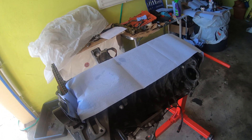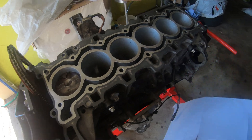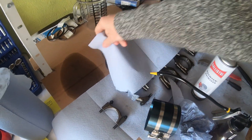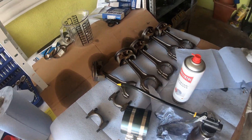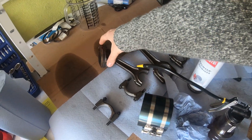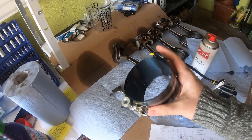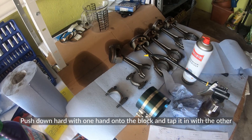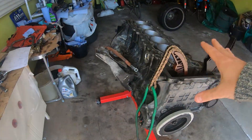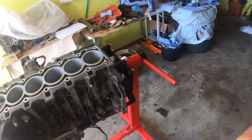All right, it's another day in the garage. If you remember last time we were putting in the pistons, having a little bit of trouble with the piston ring compressor. But I've kind of figured out a system, so I'm going to keep putting these pistons in. The process again is: clean the bearings, lube up the cylinder walls, put a little bit of oil on the piston rings themselves, shove them in here, tighten this down, and tap the piston in without hitting the crankshaft. Still haven't received the valve in the mail yet, so once I'm done this I may start to rebuild — at least take it apart and clean everything so that it's all ready to go.